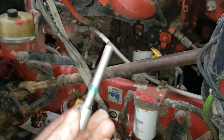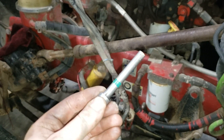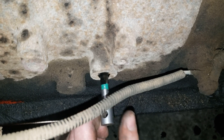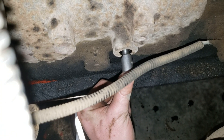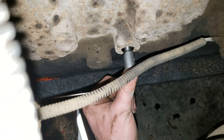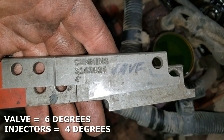On the balancer you're gonna find a spot that says 'insert pin.' You're gonna rotate the engine over to that spot, then take this pin from the timing and wedge kit and slide it into that hole. Make sure it slides in — not all the way — pull it back out, rotate the motor over to that point, and then you're gonna hear a nice little click. That's gonna stop it from going backwards or forwards; it's gonna fully lock the crank.